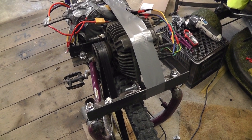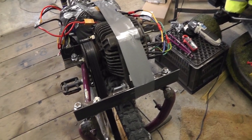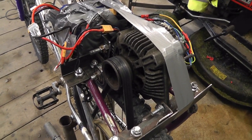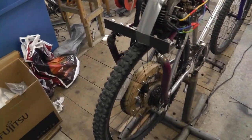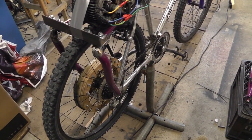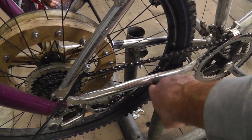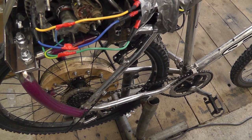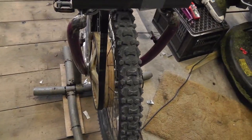What happened to the tooth pulley? It didn't happen. I would have had to make a tooth pulley down here and link the two, but to be honest I had to weld the other pulley and my welding wasn't that great — it ended up being a bit wobbly. Another issue with this setup: during some testing, some of the spokes hit the mounting stand and two of the spokes snapped off, so they will need to be replaced. And to replace those spokes will require taking the whole thing apart.